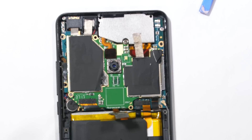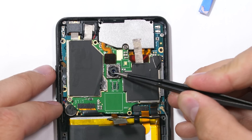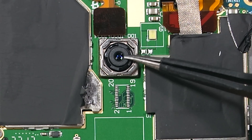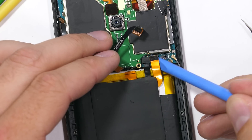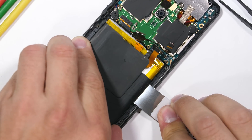We can see the large silver laser projector box up at the top — I'll take that out in a second. The main rear camera is a 16 megapixel with no optical image stabilization. I'll unplug the battery and the rear NFC pad, and lucky for us, even without any magic pull tabs, the whole battery can come out of the frame pretty easily.